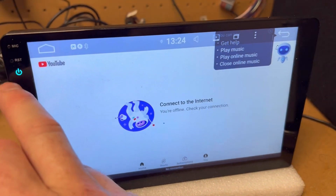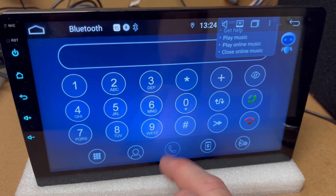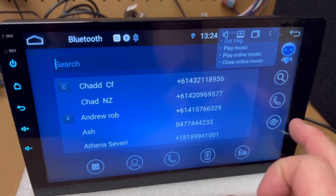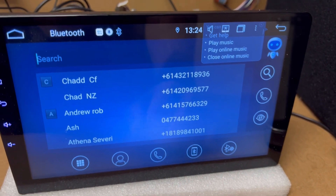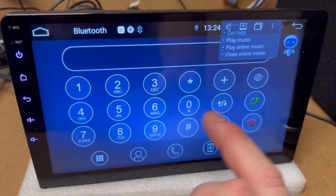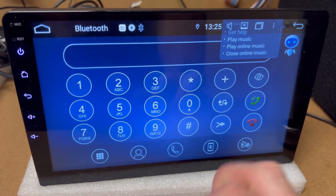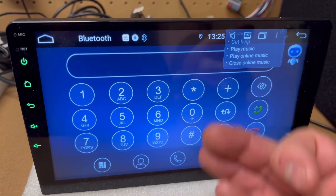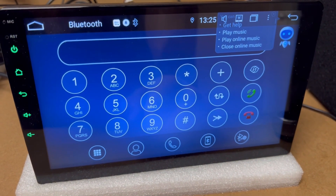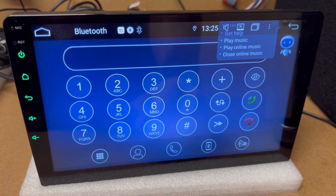A lot of people are going to want to use it for Bluetooth, so if you have your phone hooked up just on Bluetooth — here's my phone — you can sync your contacts. To do this, you need to make sure your phone doesn't have CarPlay coming up. It's basically just making sure you turn off CarPlay and don't enable a CarPlay link. You just want the Bluetooth to connect and not trigger CarPlay. That setting is basically just under your Bluetooth settings on the device and you can turn CarPlay off.